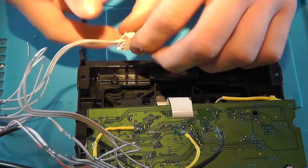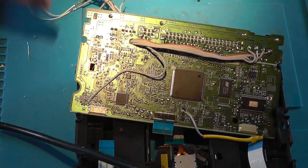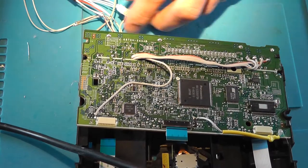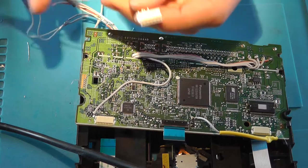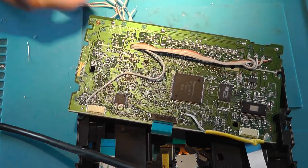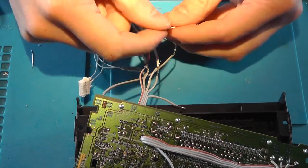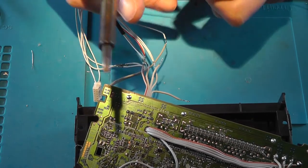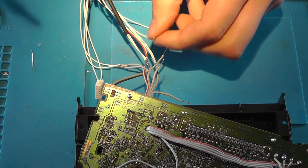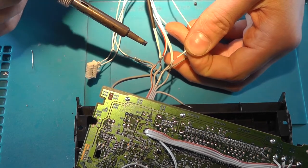So the last one of the underside of the PCB, so we can flip it. And right now there are two open connections for the things we didn't solder yet, which is fine. So grab the connector, and right now we need to solder the last ground and connect it to the other middle pin of the wires that started at the top of the PCB. I didn't pre-solder it yet, pre-tin. So that should be this one. Right there.